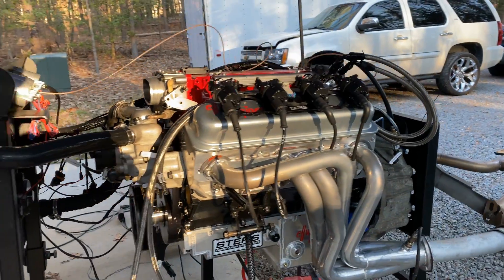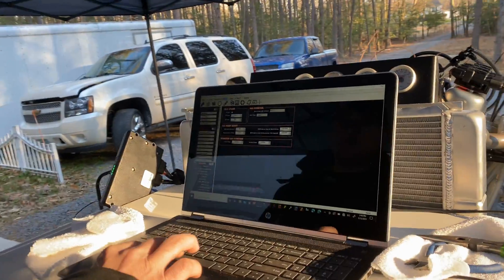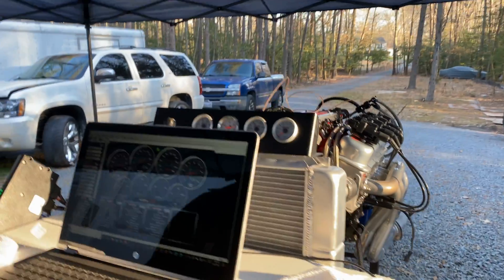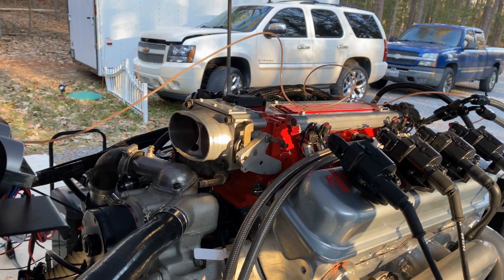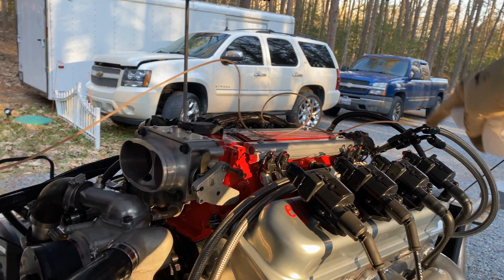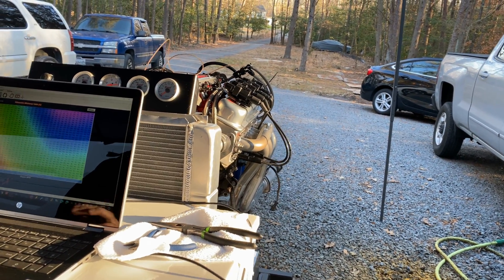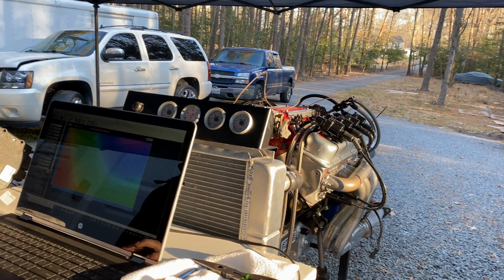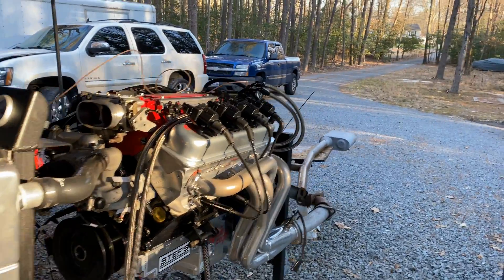Now it's doing some good loping. What's the fuel pressure? 41 pounds — right now it was static 48 at atmospheric, so it's just pulling vacuum. It was 48 at atmospheric, and this is only supposed to do like 42. Right now if I had to guess it should be around 47-48 because of where we're at on the vacuum line. Stock, it'll go down to like 38. The fuel pump's a little higher output than stock, so it's pumping more — it's higher than it should be, but you've got to tune to that.